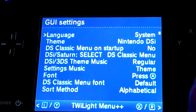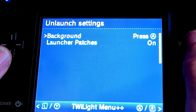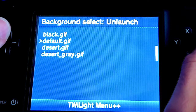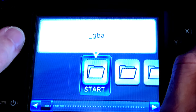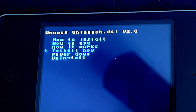To access the Twilight settings menu, press Select on your DSi, and when the DS menu appears, tap the DS icon at the bottom center of the bottom screen. Focusing on the bottom display, use the left and right shoulder buttons to scroll through the tab choices until you get to the Unlaunch menu. You'll be given the option to change the background color in Unlaunch — press A and change it from the default to the color of your choice. Once you've made your changes, press B to exit the Twilight settings menu. Now you're ready to launch Unlaunch for the first time.